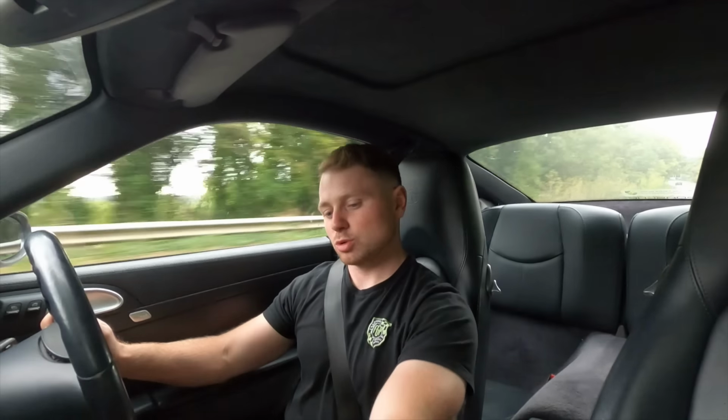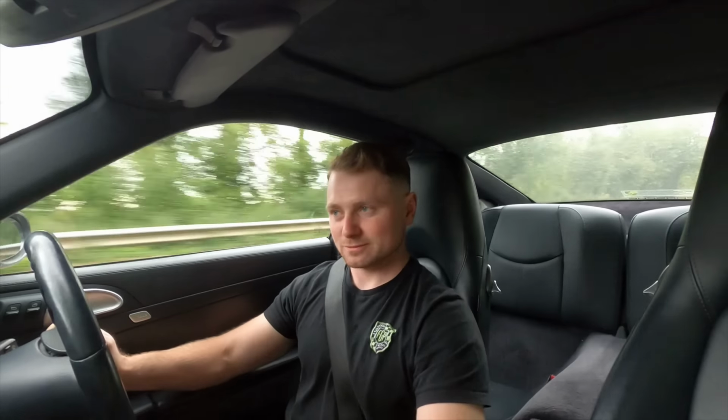So obviously we've gone for like-for-like suspension, we've gone for non-track brakes so they don't squeal and they don't need warming up before they become effective, but we've got a real kind of racy gear shifter and set of gear cables. You get a bit of noise coming through, so you get resonance. The cables are what cause the noise because they haven't got the dampening rubbers around the cables stopping that resonation from the gearbox, that mechanical resonation into the cabin.